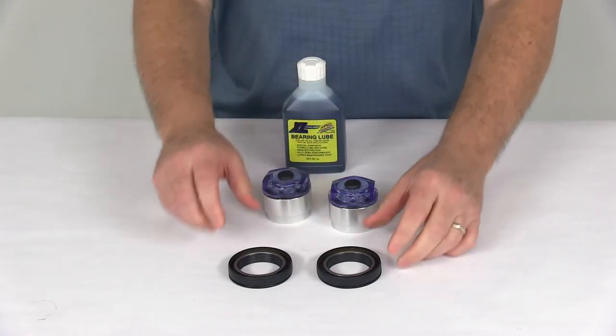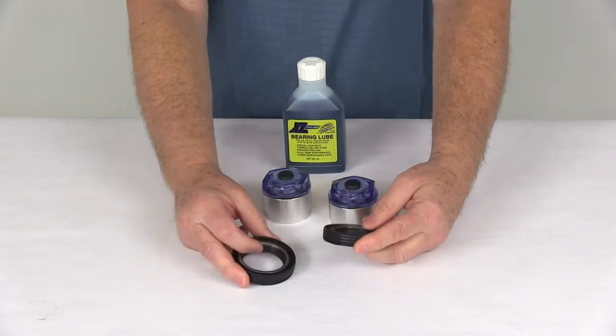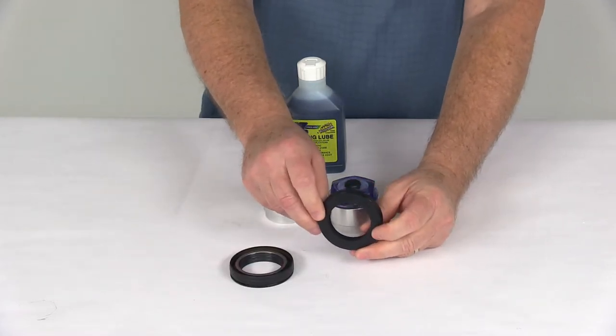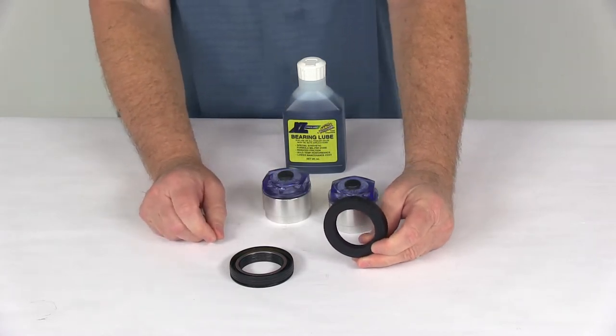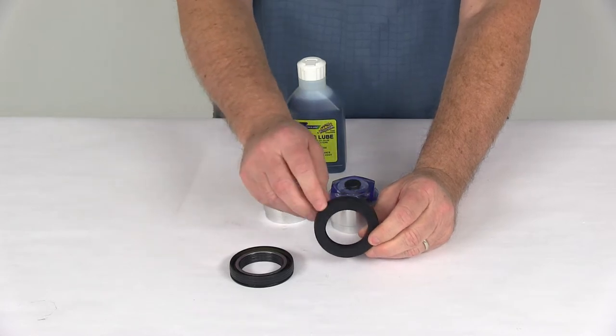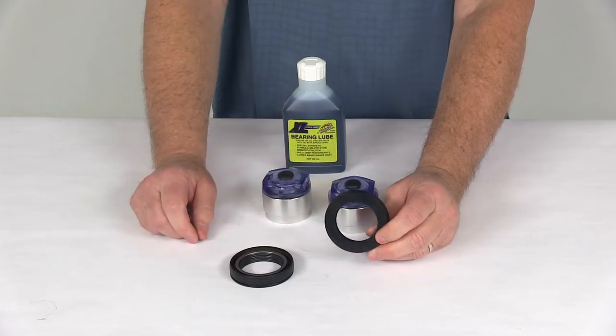You do need to replace your seals. The oil seal is a ribbed anti-rotation design. The seal is designed to fit a 1.72 inch spindle outside diameter and a 2.56 inch hub inside diameter. This is not for use with the 1.68 inch spindle.